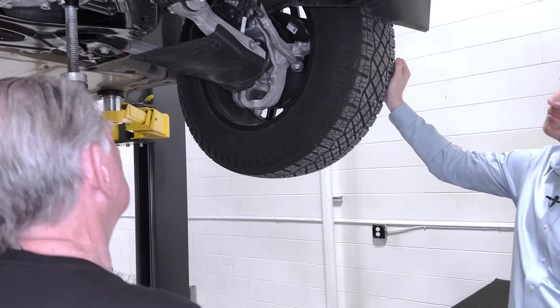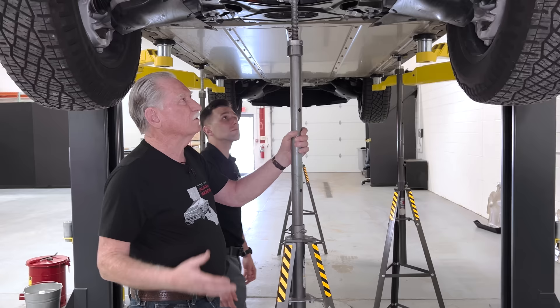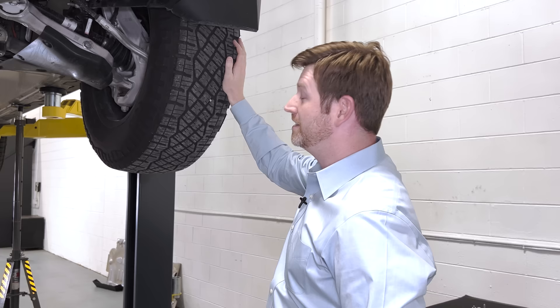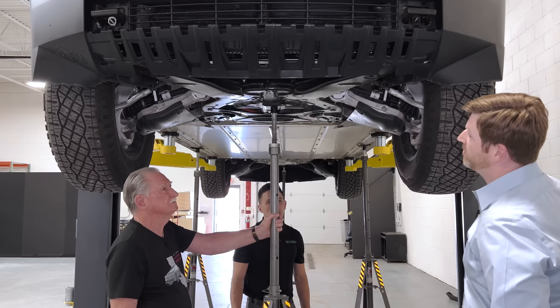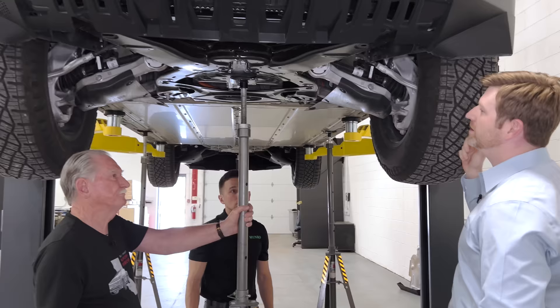There's more to this because it's even got a little blue inspection mark on it. Typically, this vehicle has a 20-inch wheel and something like a 285 tire — roughly 35 inches — which is actually a little bit smaller than you'd see on vehicles like the TRX or Raptors running 35-inch-plus tires. Those larger, higher-volume tires are extremely forgiving for SORB and may not require as many countermeasures given their size. But the Cybertruck has a larger wheel package than a lot of off-road-focused vehicles, where sometimes those strategies change for small overlap.